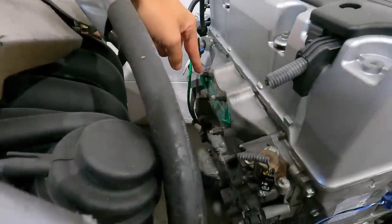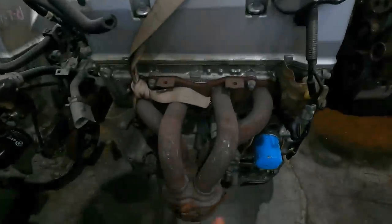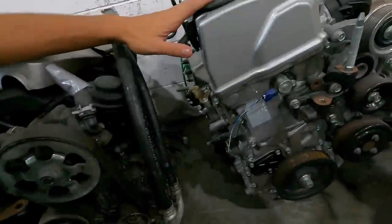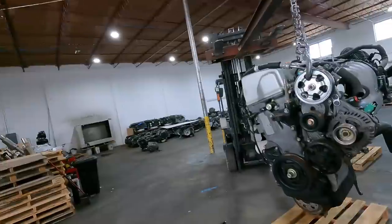I really don't want to have to put rods in it and tear the whole motor apart. I'd rather just do a stock motor, low boost, and call it a day. We're thinking about the newer style just because it might save us more room inside the engine bay, especially with those seats cut out on either side. But after some thinking, we're going to go ahead and go with the older style that has a traditional four-port header, and we're just going to make our own custom manifold when the time comes. I know those can handle a little bit more power, so that's the main reason — in case we ever turn the jet boat up to 350 or 400 horsepower.